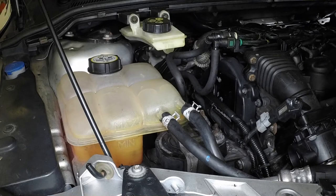The coolant level varies with the temperature of the engine and is visible through the expansion tank. When the engine is cold, the coolant level should be between the max and min marks on the front of the reservoir. When the engine is hot, the level may rise slightly above the max mark. If topping up is necessary, wait until the engine is cold.